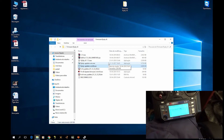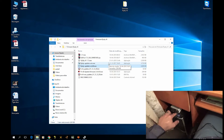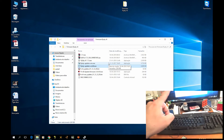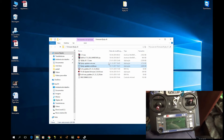The problem was I was putting the radio on update mode and then plugging in the USB. You gotta do it the other way around — plug the USB, open the software, and only after that put the radio on update mode. Like this, it will connect.